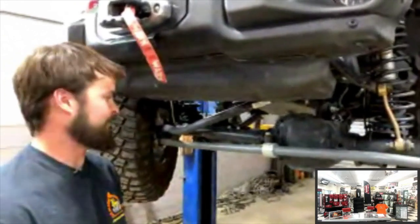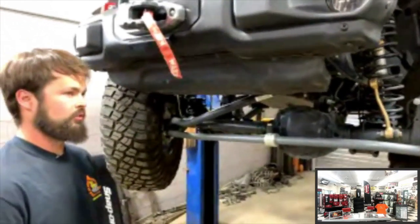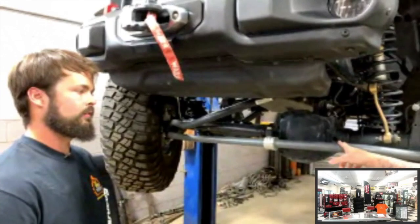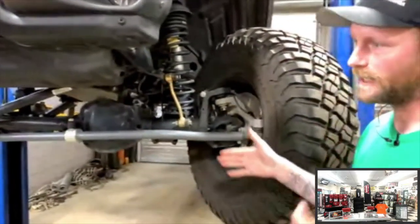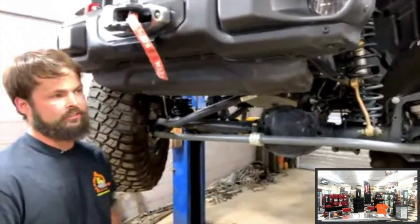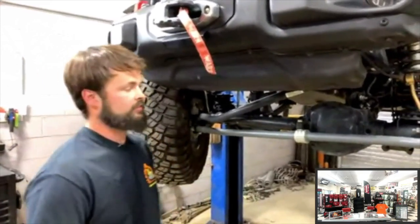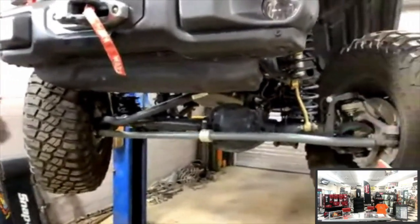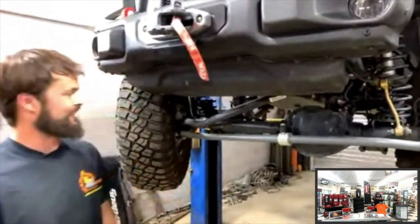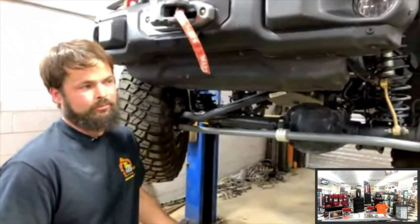When you steer, you're really only moving one tire directly — the tie rod moves the other tire along with it. If you bend a stock tie rod, the tires toe in, giving you bad alignment. On a Jeep, off-toe can cause death wobble, making the tie rod a key upgrade. A steering stabilizer does help — it is a damper — but most of the time there's another underlying factor causing the wobble. A steering stabilizer mostly just dampens whatever the problem is; it doesn't fix it.